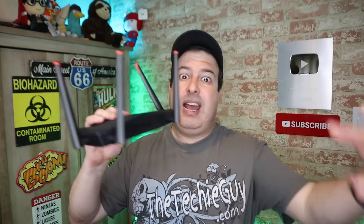Let's start by looking at the hardware. When you connect to your service provider, they typically provide you with a modem — the piece of kit that connects your house to the service provider and out onto the internet. You might also get a router, which gives you Wi-Fi and LAN connectivity and is responsible for managing traffic around your network. Some providers give you a gateway or combo unit, which is the modem, LAN, and Wi-Fi all in one piece of hardware.